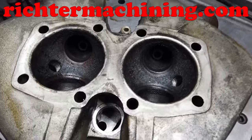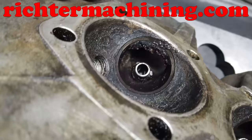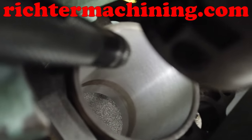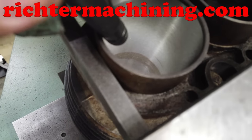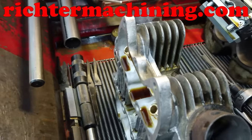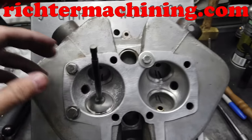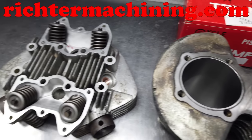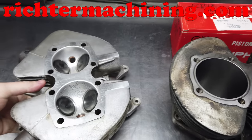I'm going to get some of that before action so you guys can see the contrast and change. Look at that — swampy. I think you're going to be able to kind of see what is going on. That is why I wanted to start on this side, because we can already see at 10,000ths it's not looking too hot. I got the cylinder drip-drying here. The head is now ready to get the seats cut. I honed these guides. All four seats are cut — three-angle faces: 30, 45, 60, and then that de-shroud. Top end's all done and ready to go back.